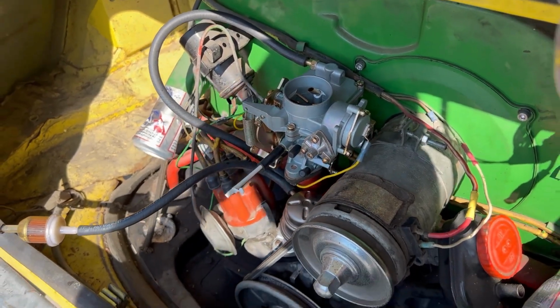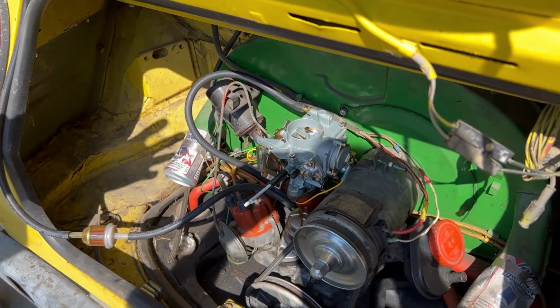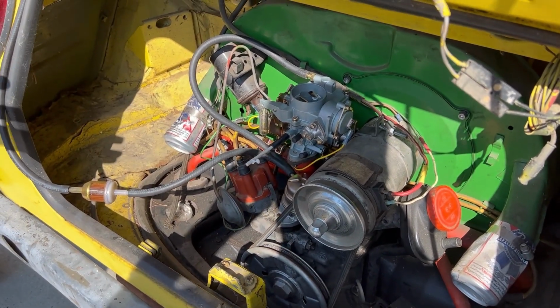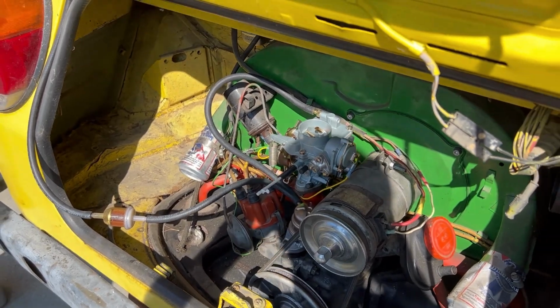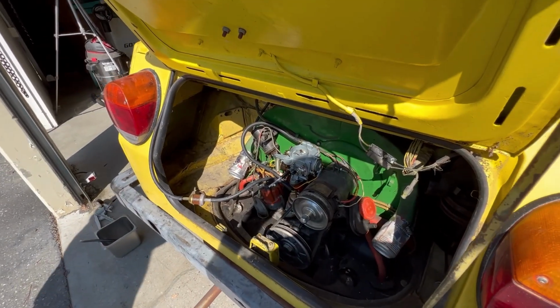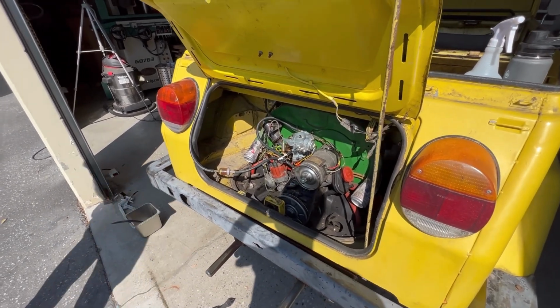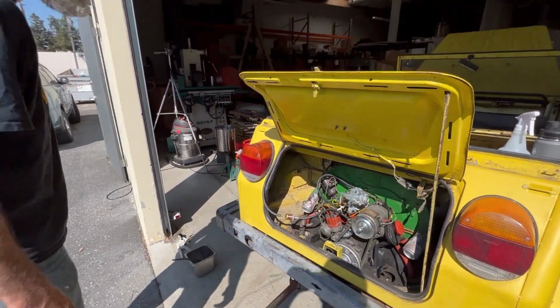That's okay. What do you think that's all about? As the choke's opening up, the idle circuit's not behaving correctly. We haven't adjusted the carb at all. Oh, okay. So it's not like a drop in and go. You gotta tweak it. Yeah, you never know. Doesn't seem to be. Cool.